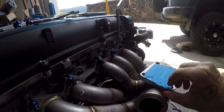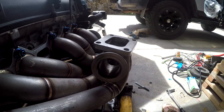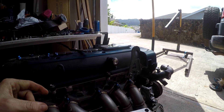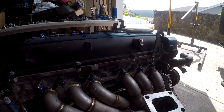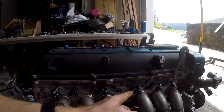It's a pretty good build quality. The welds are good. The main problem that I've had with it is fitment. This 1/2-inch stainless steel flange is beastly — it's massive — but the problem is the bolt holes do not line up. They're all a couple millimeters off. The only way I could bolt it in was without three studs when I initially put it on. I tried to elongate each hole with my corded drill, trying to cut into it with the side of the drill bit. I tried to Dremel, destroying my Dremel bits, breaking my regular drill bit.